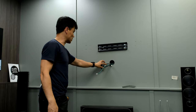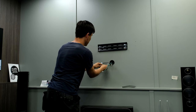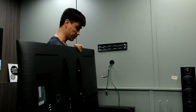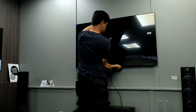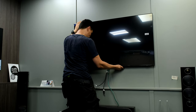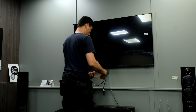If you've got two of you, you can obviously plug the cables in while holding one end each. I've only got myself so I shall be doing it solo. We've got those arms with the hooks on the back of the TV, so I'm basically just going to lift it on and hook it onto that plate. That feels to be on. One thing you can do to check is give it a quick slide side to side while you're holding it — that shows it's on the rail. Peep your head to the side and have a look. That is pretty much it apart from plugging the cables in.